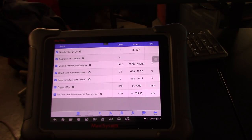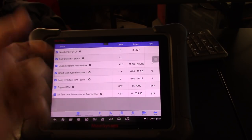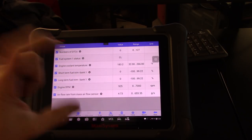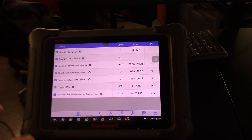I was doing tests, and when you release, the throttle was staying open. I have a video of it. I showed this to the customer. It opens up completely, and not smoothly. I was accelerating the car softly, and it stayed and then went completely full. The same thing when you release it slowly, it goes to that same open position, and then slowly comes back. So that's why we replaced the throttle body. And no more stalling.